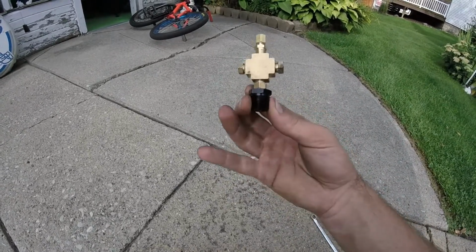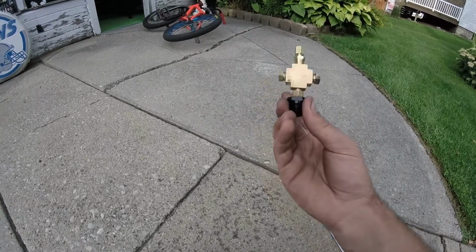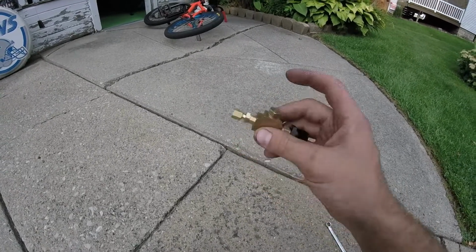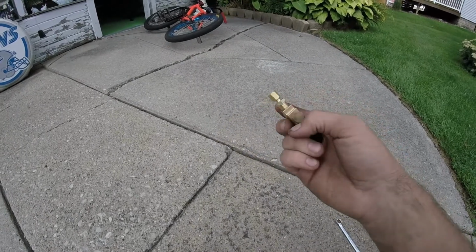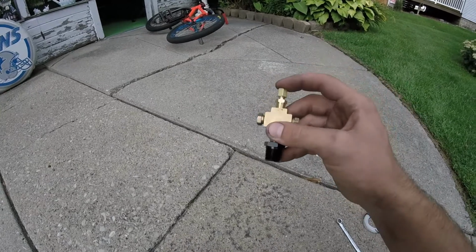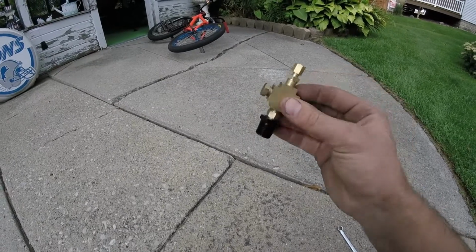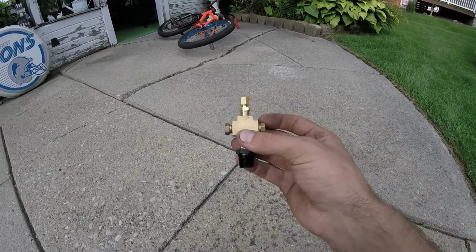This is the 3/8 inch to 1/8 inch NPT adapter, the double male fitting, and then a block, which has the one going in and then 3 out. I got these 2 blocked off. One of these will be used for my oil feed line for the turbo in the future, and then the other is just going to be blocked off forever basically. And then this is already the one for the oil pressure gauge. For some reason it didn't go all the way in, so I cranked it down as good as I could, and I guess I'll see if it leaks.